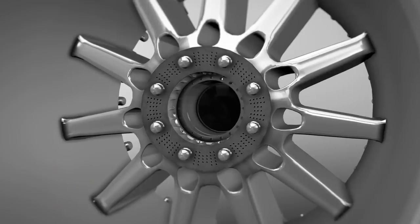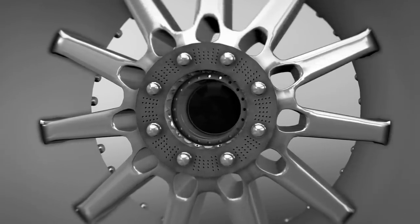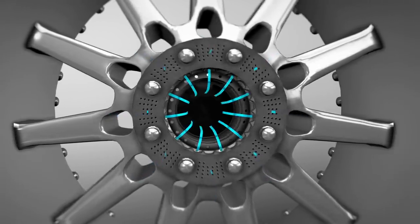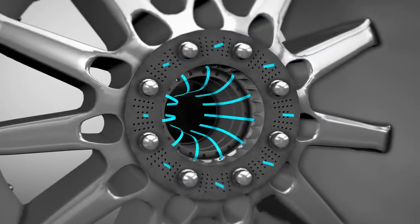The spare holes correlate directly with a spacer that Mercedes have attached to the rear wheels. The spacer itself is basically a little shim that sits on the mounting face of the wheel. It's got the locating pins, but it's also got a series of little perforations, and that's what Mercedes have been using to try and get airflow through the wheel and direct it outwards — so it's been a little bit of a controversial addition.